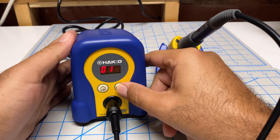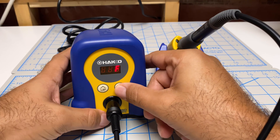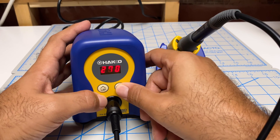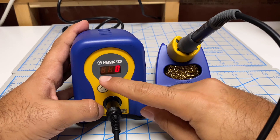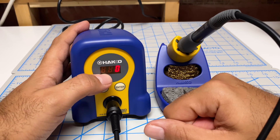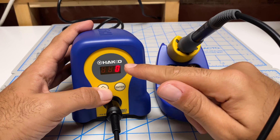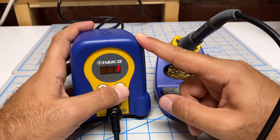Keep holding the up button and it says 01. Setting 01 is the temperature selection — do you want Fahrenheit or Celsius? We'll leave this as Fahrenheit. Number three is the low temperature error setting — we'll leave that as the default. The one I really want is number 11, which is how we actually select a temperature. Earlier in the video you saw me selecting individual digits — that is setting zero. Or I can use the presets, which comes with up to five presets preloaded. I'm going to flip this over to one, which is using presets.